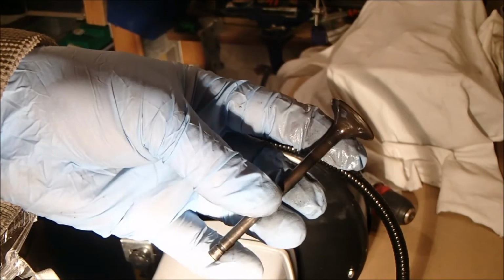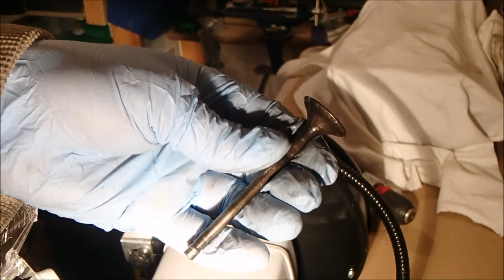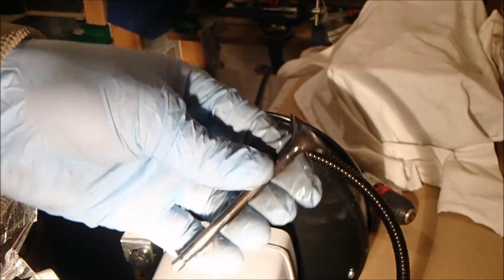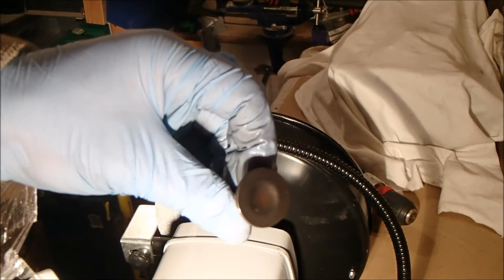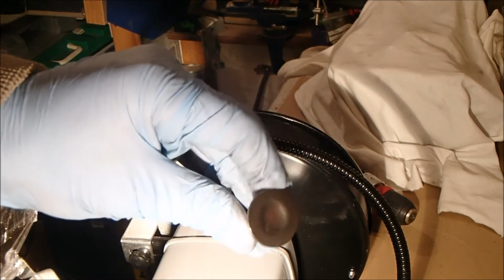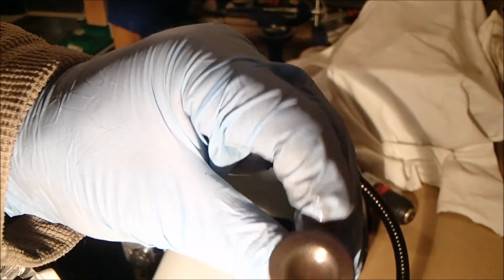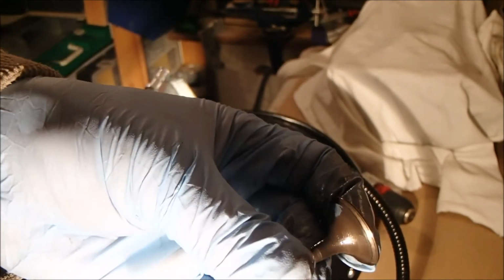valve. I wrapped the valve in masking tape to protect the stem, and lightly clamped it in a battery powered drill and rotated it as I carefully put it against the wire wheel, checking every few seconds to make sure no scratches were being left. And as it turns out, I can't see a single scratch in there. It seems to be back to sort of the original metal finish, but with no ill effect.